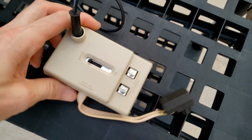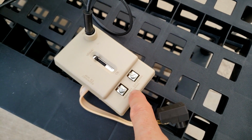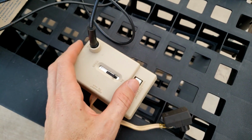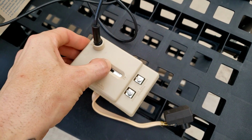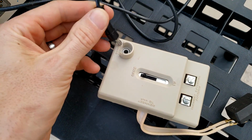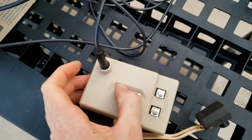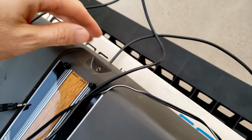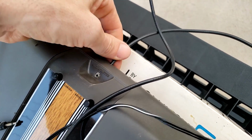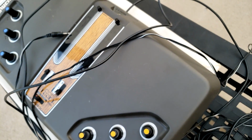Check it out. So these old RF boxes, you can connect your pre-existing old school kind of 300 ohm antenna here, and then just switch it to your antenna so you can watch analog TV. Obviously it's not that case anymore, but that's kind of how this would work. This piece here goes to the console itself, or the game cord, and make sure you have this on the game setting to run the game. And this is hardwired into the back of the Odyssey 500, and if you pop open the console, you can see this gets routed into kind of like an RF box inside.